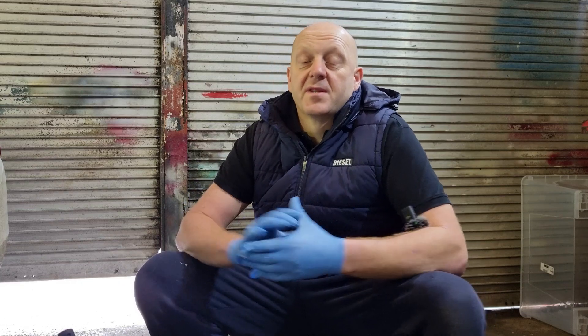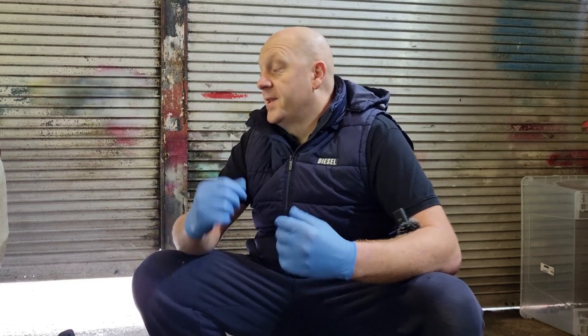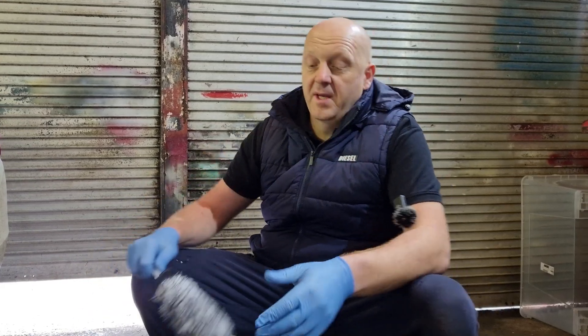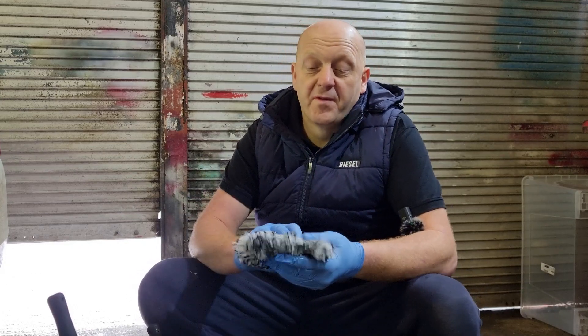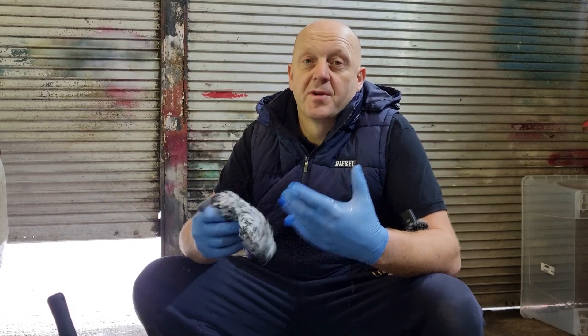In the case of this car, I'm going to use the safest brushes I have, because the wheels are not in too bad condition and they have a glossy black finish. If your wheels are in perfect condition and you want to keep them that way, you need very soft brushes — a microfiber brush, a wool brush, one for smaller places, and a wash mitt for wheels that you can wrap around the spokes.